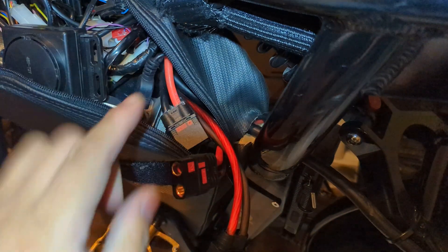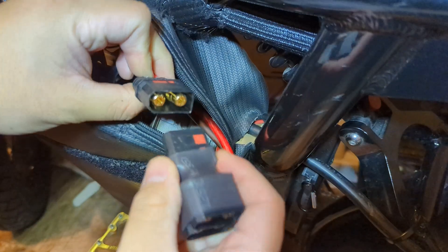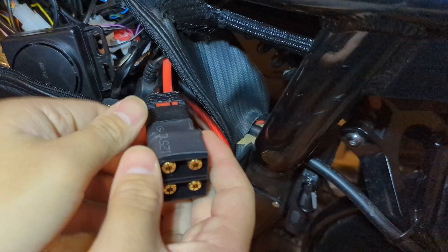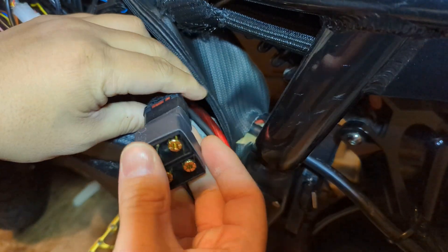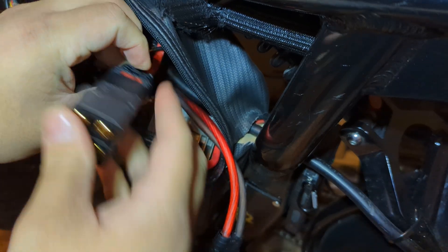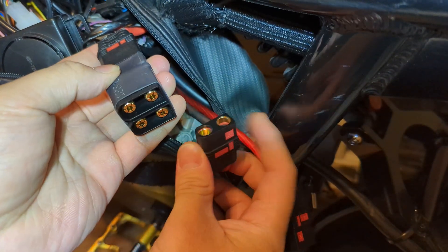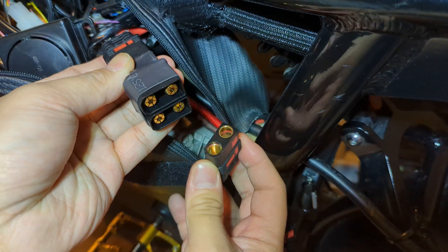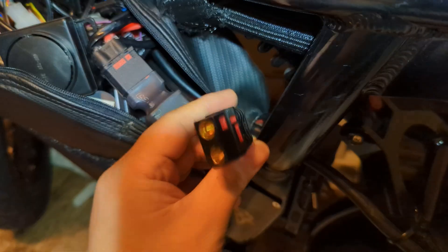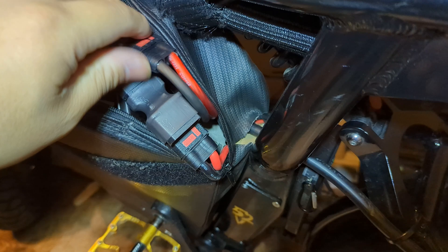Alright guys, we're going to begin to connect the Y connector. The main battery harness to the controller — I'm going to connect it here. Make sure you connect it all the way. These QS8 connectors are usually a little bit tougher to put in — the wire gauge is actually thicker, but overall these connectors require a little bit of force to make sure that they sit with no gap. Now over here is where we have our main battery. This QS8 will go in here. So that one's connected. We're not going to connect the additional battery connector just yet because we want to measure the voltage first.